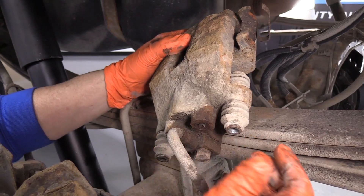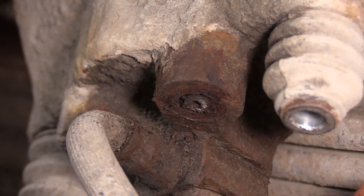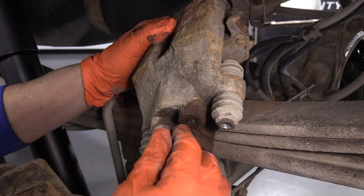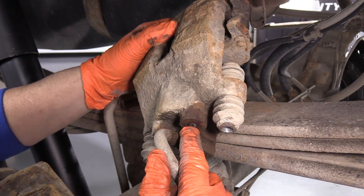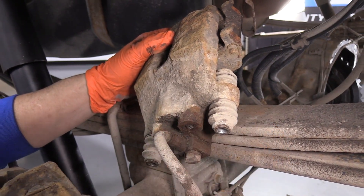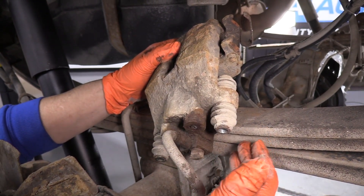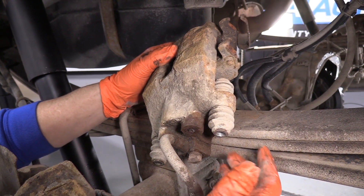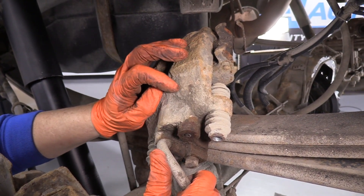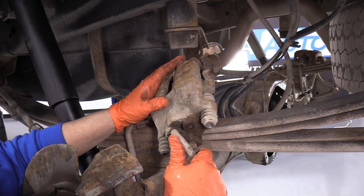When we did a rear brake job on this truck, the driver-side bleeder screw was frozen and snapped off flush with the caliper — this does happen. When it happens, I replace the caliper, because the materials are so thin that if you try to easy-out or drill it, you'll get drill material inside the piston. It's not worth the time and effort — just buy a new caliper. I like to do things in pairs: I have a brand-new caliper on this side and I'm getting one for the other side, because you want equal hydraulic pressure for equal braking. You don't know if the piston seal on the other side is starting to wear, so I strongly recommend replacing two calipers even if only one needs it.